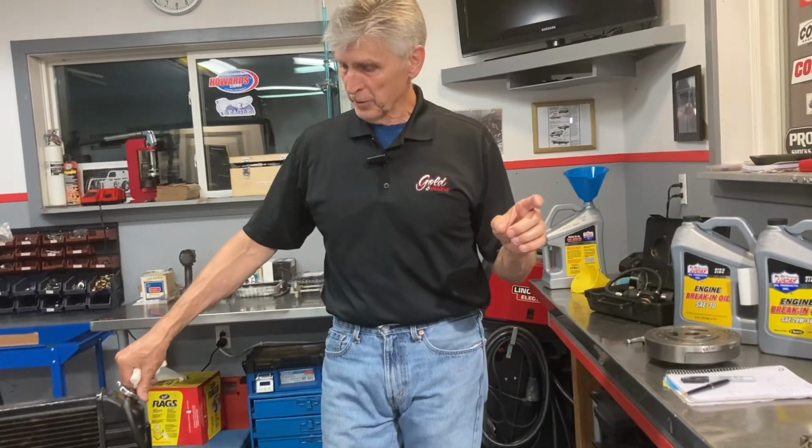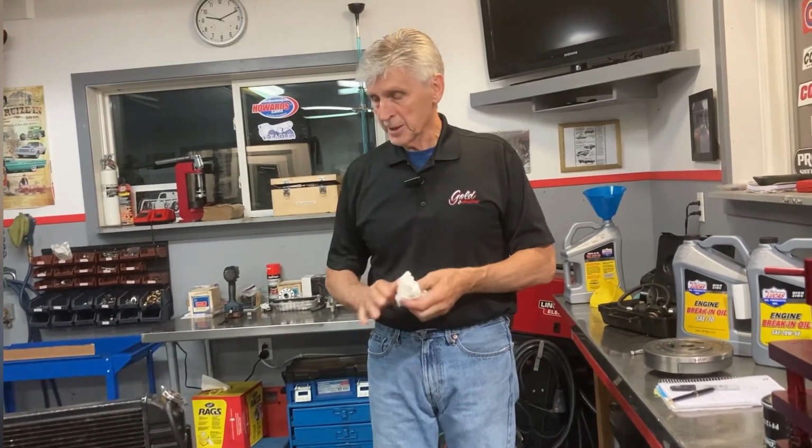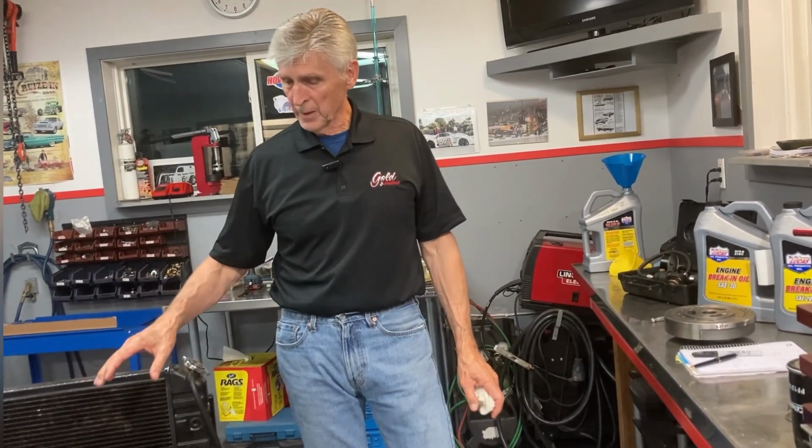A couple other diagnostic checks we will get to in a future video. What I'm going to do after this video is done is change all the valve springs. The valve springs on it now are just the original stock springs. They only have 70 or 80 pounds on the seat and less than 200 pounds open. So I'm going to put in the correct valve springs. That's an important thing to do as well. But in the process, when I get the valve springs out, I have to take every plug out anyways.